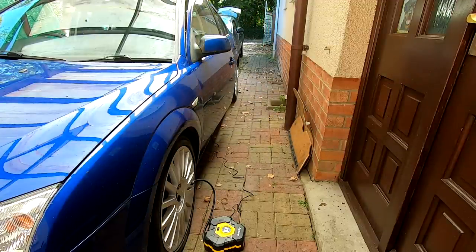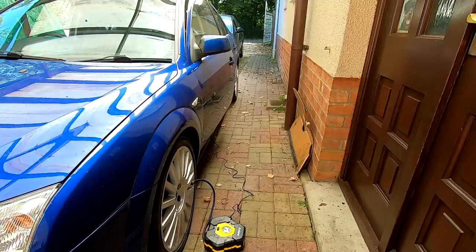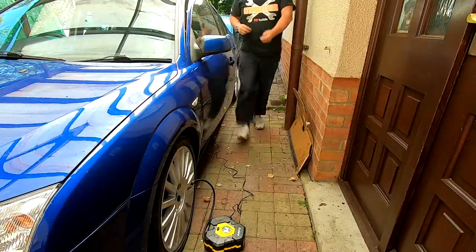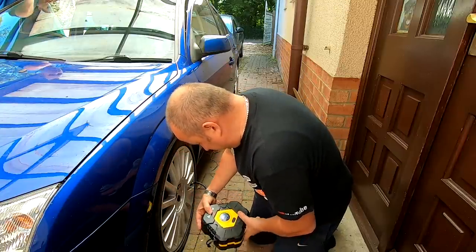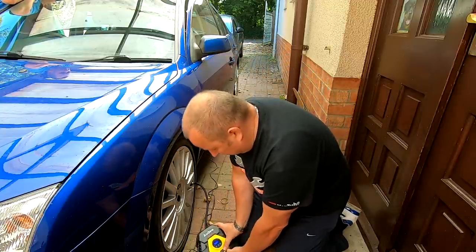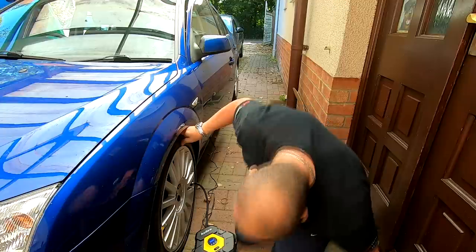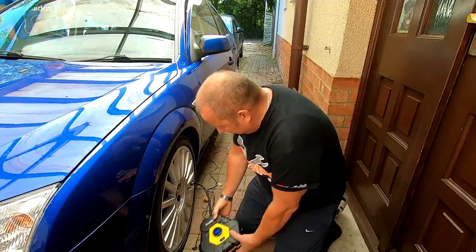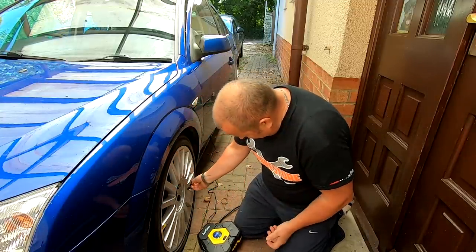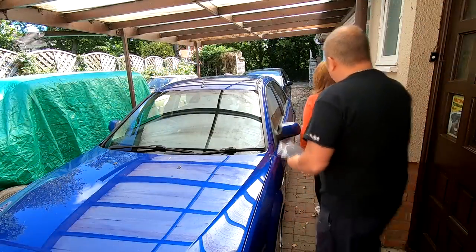The wire's stored inside and goes to the 12-volt supply. This tyre's a bit flat so let's just plug that on. Let's power it up — I'll start the car up first and just leave it ticking over. It's showing 33 in here but I think it requires 36, so let's turn it on. We've got 36.5 in there now. I might as well check the others while I'm here — I'll go around and do them.